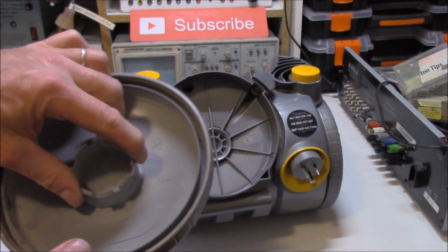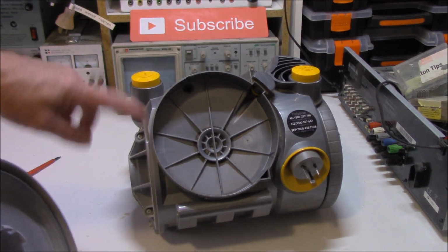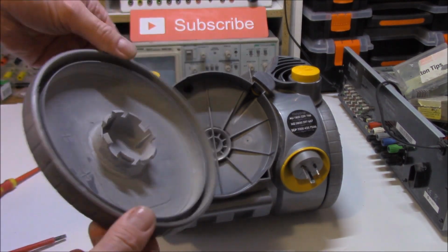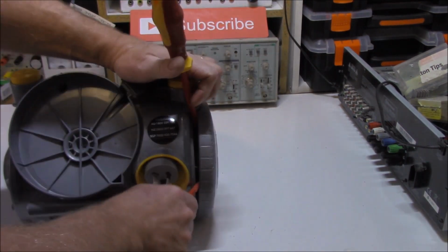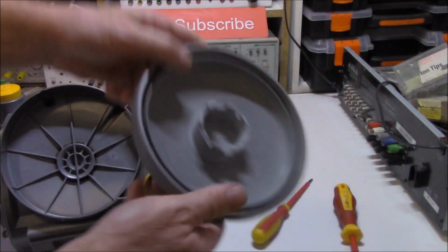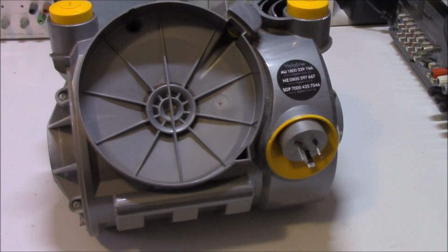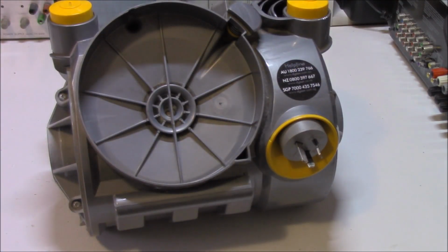So that's all these little teeth that hold it into place. So just gently pull it off. But like I said, I recommend a couple of screwdrivers going around because these are quite old and eventually they get brittle. And that should pop off. Once again, make sure all your teeth are in good nick. And there's pretty much six Torx bit screws that have to come out. 1, 2, 3, 4, 5, 6. So they come out next.